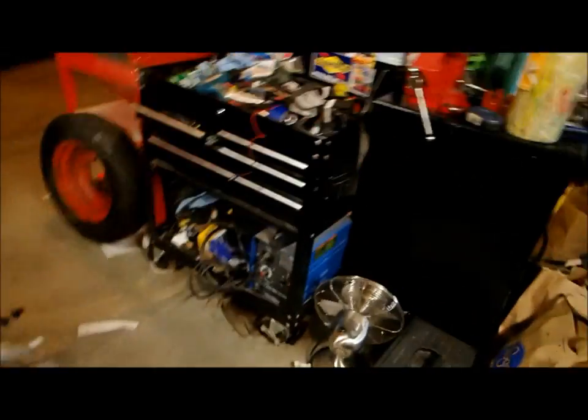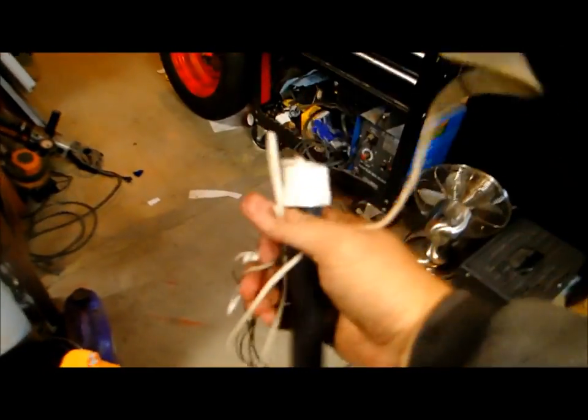You get this thing to hold it open, and then a little PVC pipe with a cap on it that worked well as a pilot. A lot of work, but it could have been a lot worse. Now it's just a matter of putting the shaft back in and putting it through the bushing — the rest is downhill, just reversal: two bolts for the shifter and all that. I hope that was helpful. If nothing else, you got to see what the tool looked like, and since I've done it, I'd say the tool's worth it. If you have any questions, you can email me at dan.pierce@mail.com. You guys have a good day.